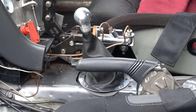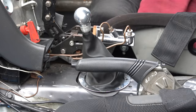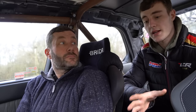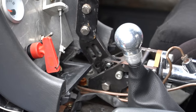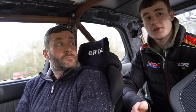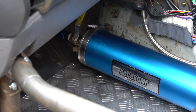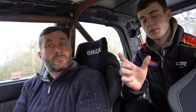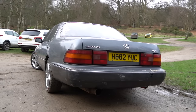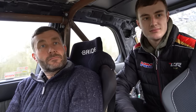One of the key supporting mods is we've fitted a Nissan 350Z gearbox, because all LS 400s were originally automatic. We've now done a full manual swap with a twin-plate ceramic extreme clutch and a flywheel we machined ourselves from 22 kilos of billet down to about 7 kilos. We also used the Nissan carbon propshaft from the 350Z — it was only slightly too short — and we made a small adapter to connect it to the diff.